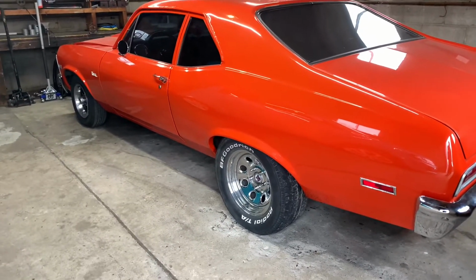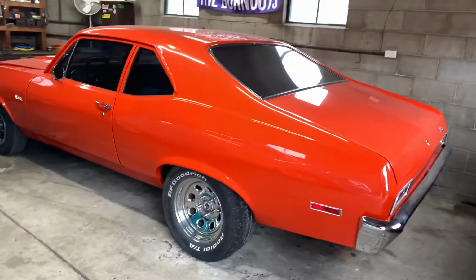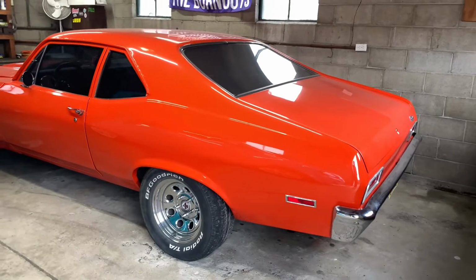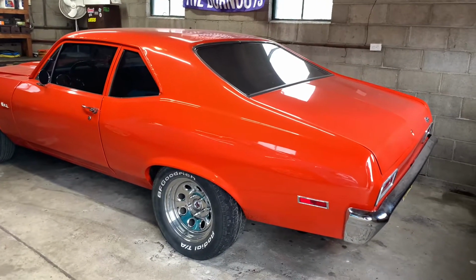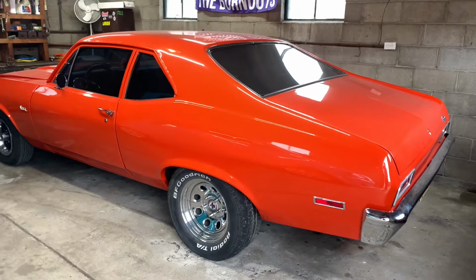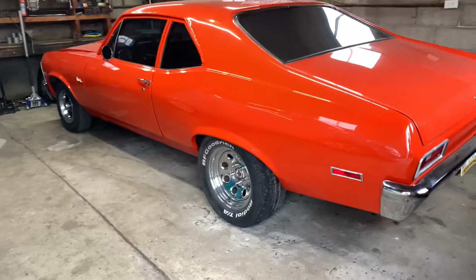So I'm gonna go in and clean up, and then I think I'm gonna take it down the road, maybe try to break that rear end in. And it says, you know, 5 times for 15 minutes. So I figure if I drive to my parents, that's about 15 minutes. Drive back, let it cool off in between. Do that a couple times a day.